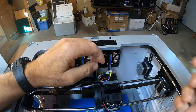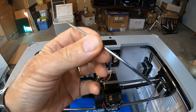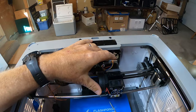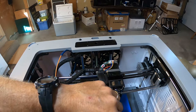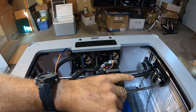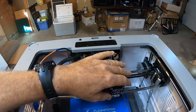The next step is to take your 3mm hex wrench and unscrew the screws on the fan on the front. In some early videos I took the fan off and moved it to the side, but you don't need to do any of that. This is the optimized procedure — at least from my point of view it's been very reliable lately.